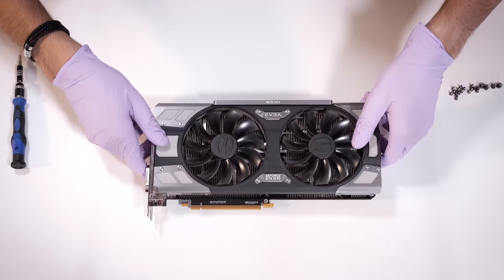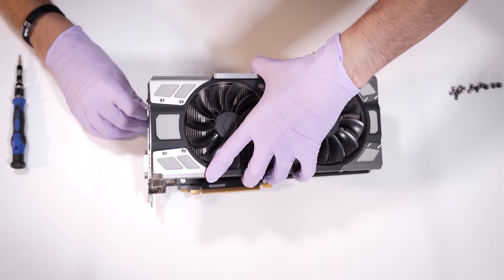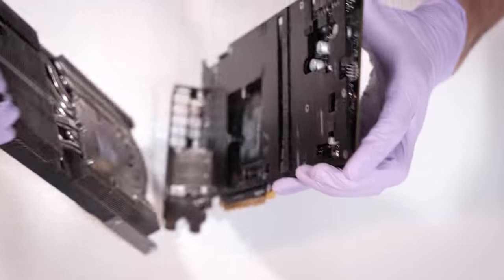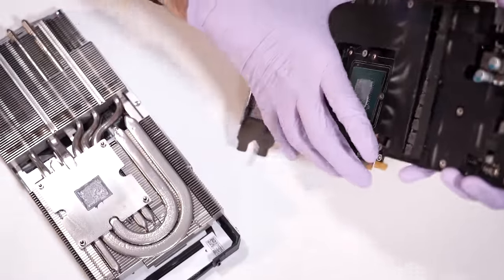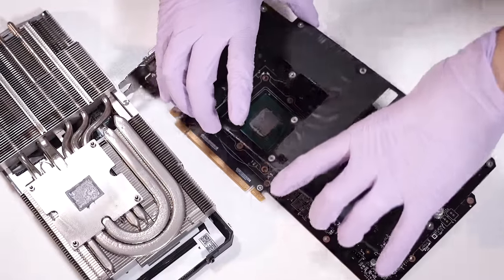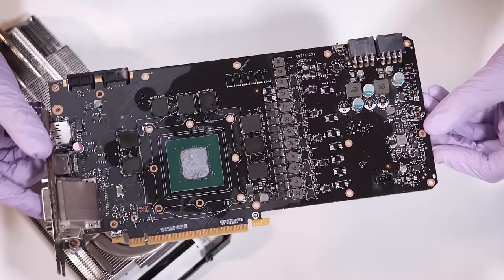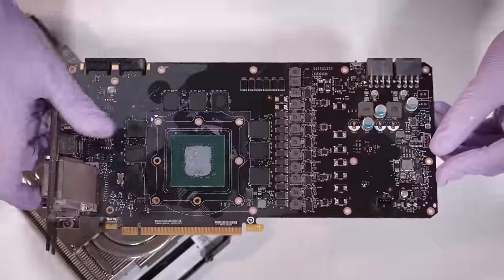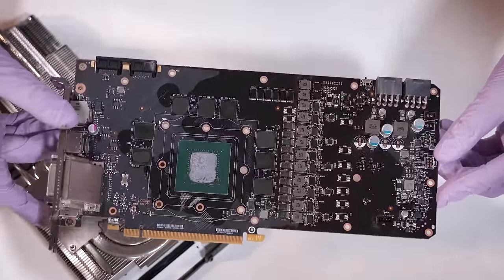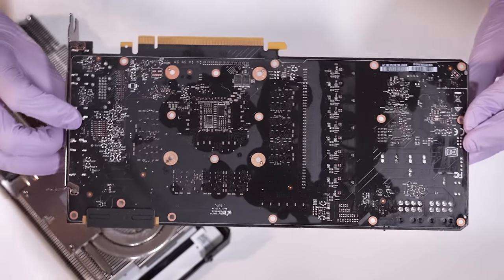We're going to start with a beefier Phillips head, moving all the way around the card. We'll get this back plate off — you can see we've got a few thermal pads here as well, which makes this plate a bit functional. There's a lot of residue on the back of this PCB, which is what we should expect for a card this old. Just a few more screws now holding the circuit board to the cooler and the shroud. We'll flip this back over and it should lift right out. You're going to have a few cables attaching the cooler assembly to the board. Here's that mid plate I was talking about. This is the EVGA GTX 1070 For The Win PCB — you can see the thermal paste we'll clean up and replace.